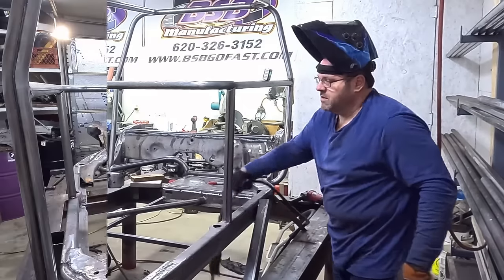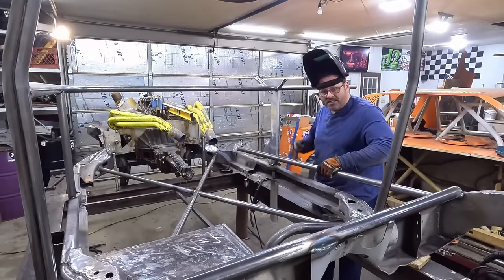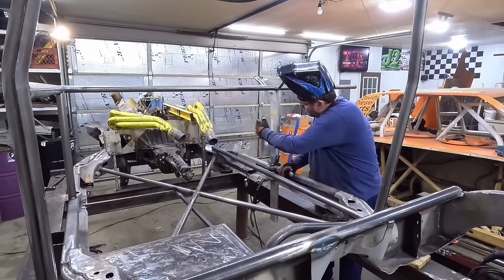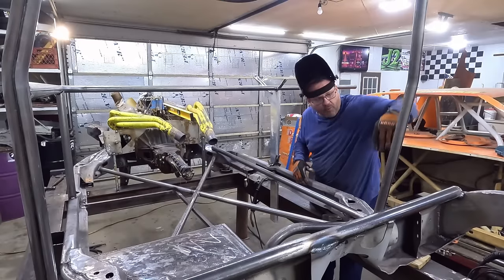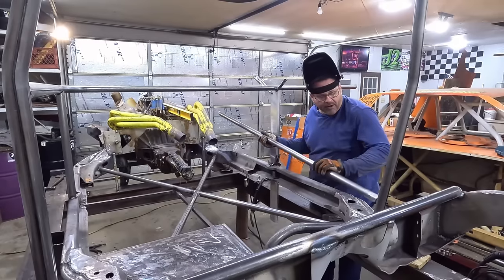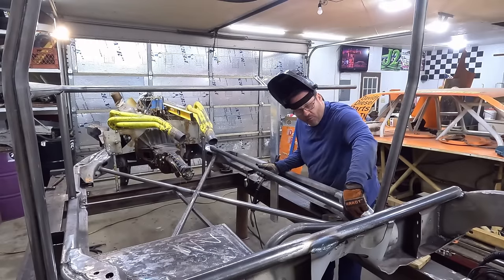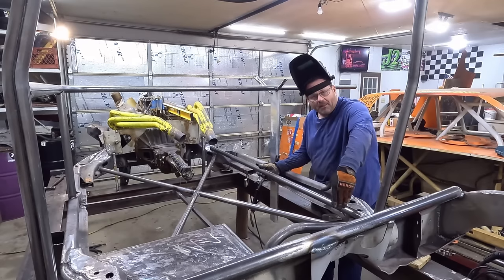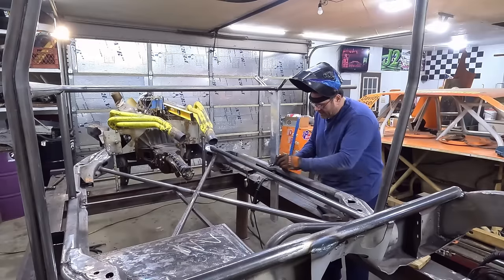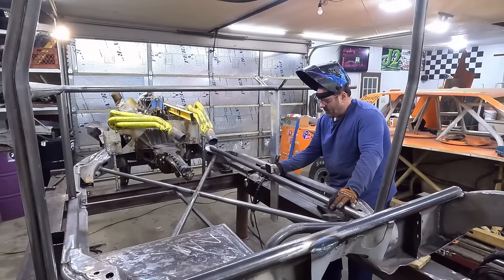I like it. So we've got to get this side tied in now, and we're not going to tie it in out at the frame rail. This frame rail right here — I don't consider it structural, just like I did on the crush. I want a completely separate tube on the inside here and I want it to be parallel and in line on the car. So this is going to run right with the cage down tube right here — run parallel up through there. I'm taking my measurements. I've already notched out the ends and got it ready to go. It sits high — it actually sits above the frame rail, up here on top of my pocket over my right rear trailing arm mount. It's going to be part of how I'm going to beef up that right rear trailing arm mount. But it does sit level — I just cut it until I got it to zero. So I'm going to spot it in and then we'll be able to run our down tube after that.